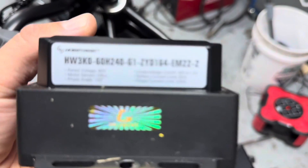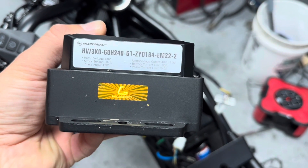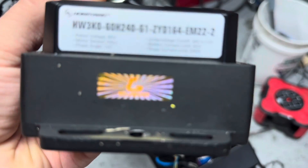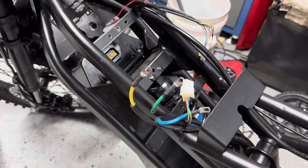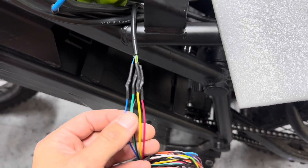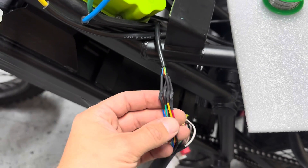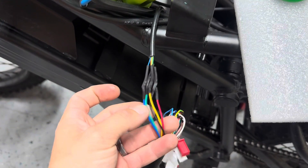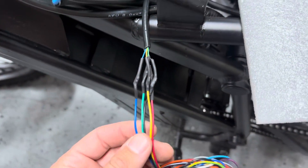Here we got the HobbyWing out — 80 amps battery current — with a little Kugoo sticker, because this is a Kugoo Wish 02. Heads up: in other countries the hall sensors do not connect directly, so we have to do a little bit of soldering. Fairly easy — just five wires and they're all color coded. Unless you find an adapter, this is the easiest way.